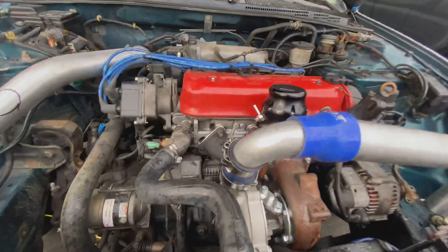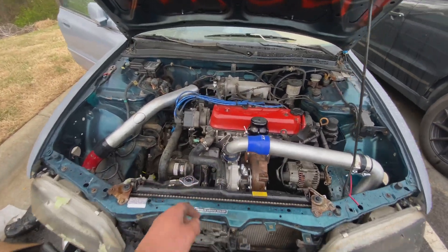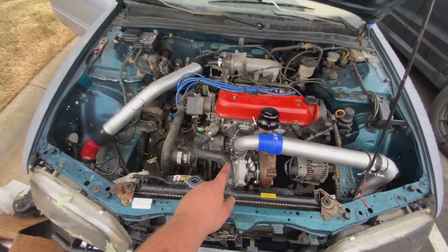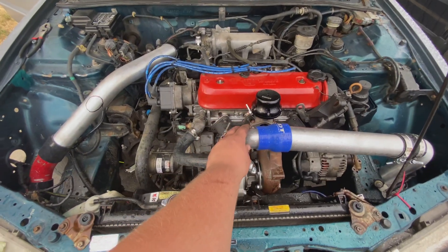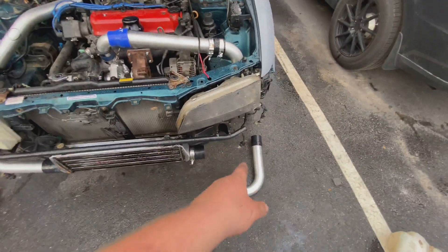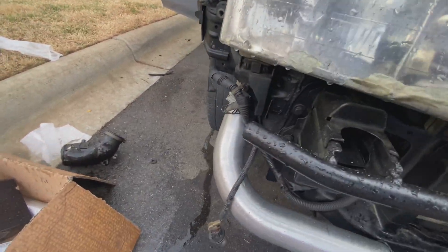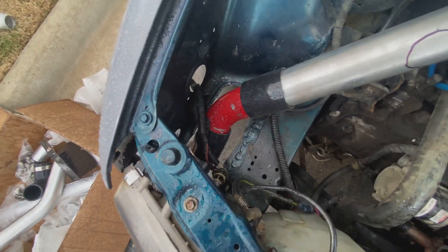With a little bit of help from Jagger and a little bit of mocking up, got this nice little adapter kind of setup here — it's also aluminum piping. Ran straight off the turbo since the turbo is a smaller diameter than the actual intercooler piping, so we got a smaller diameter out to an adapter right here. Then it just runs straight across and down. I've got to put some hose clamps on this and then it's going to run down into that pipe that connects straight to the intercooler, runs through, then runs up this 90 into here.